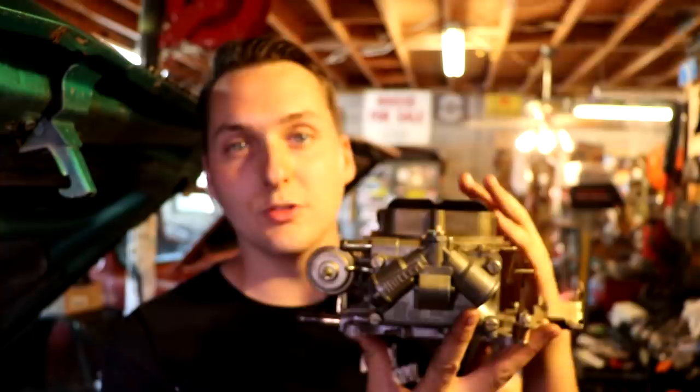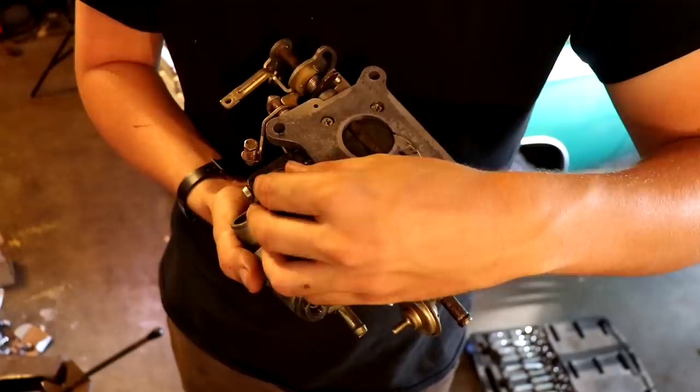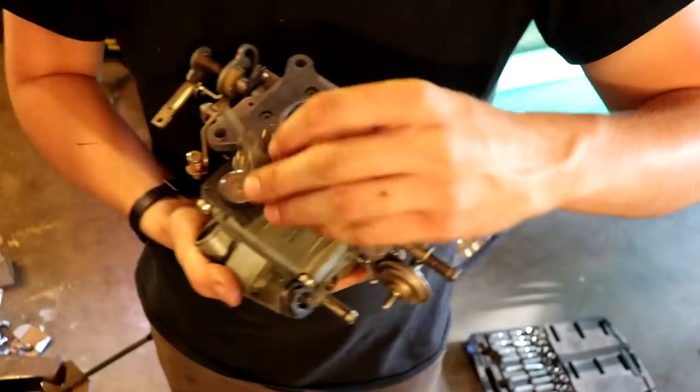He bought this carburetor and then actually sold it for another unit, and I think he was having trouble with it, so that's why we're gonna fix it today. And I'm thinking that if we adjust that, we should have a good accelerator pump. So what I've done is I've actually cleaned up the gasket surface here. So we'll pop this spring in, we'll grab the new accelerator pump diaphragm in the proper location, and now it's got that spring to it. And then we will reinstall the cover, tighten up our screws.